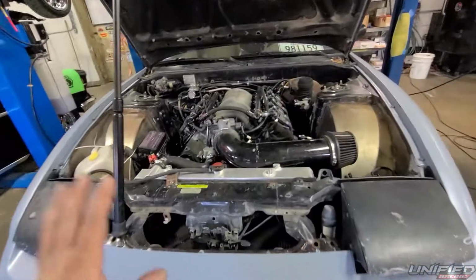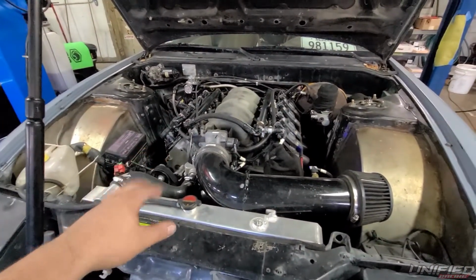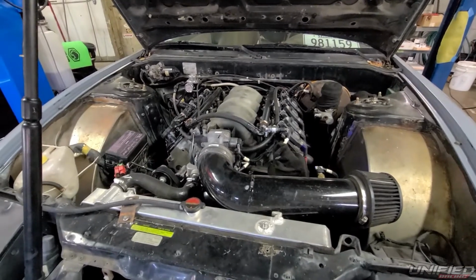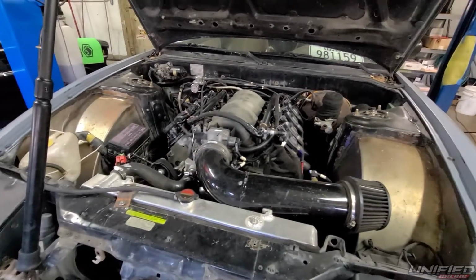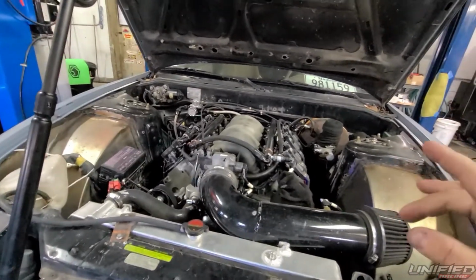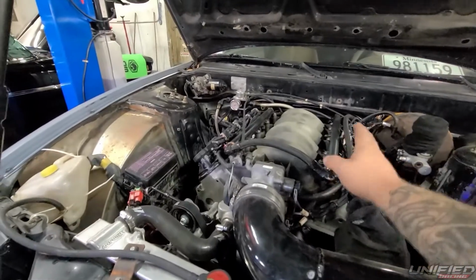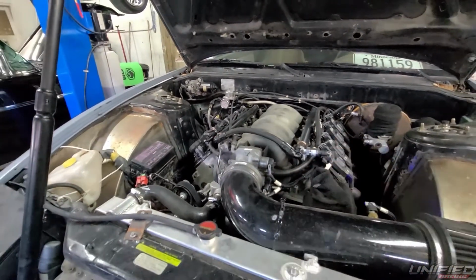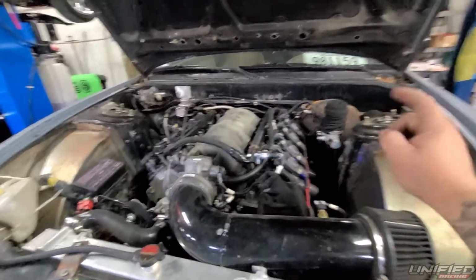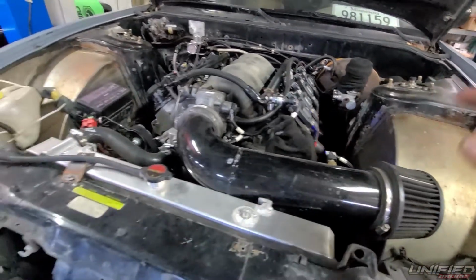Under the hood, where everything's really happened on this, this is a 5.3 liter LM7 that has some upgrades on it. Eric, as you guys had seen, tore this engine out. He replaced, I believe, the clutch and a few other parts on here. This has an LS6 intake manifold with aftermarket fuel rails, aftermarket injectors, MSD Street Fire coils, and long tube headers.